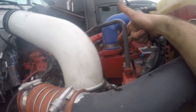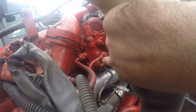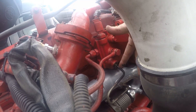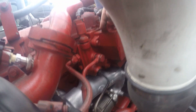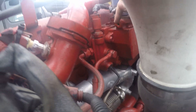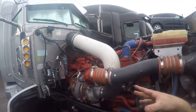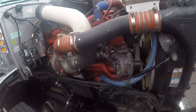This blue tube leads to a thermostat housing unit. These top two are coolant lines, and that's an exhaust back pressure tube. Inside that housing is your thermostat. On these engines it's a 180-degree thermostat, but it doesn't fully open until 196 degrees because it takes 16 degrees for a thermostat to open — a fun fact I learned from Pittsburgh Power.